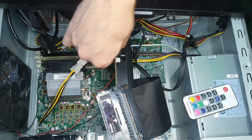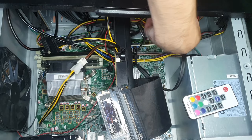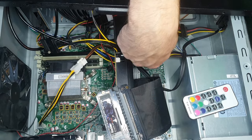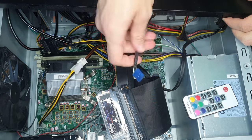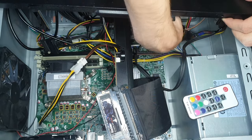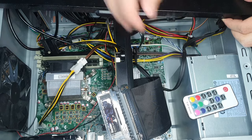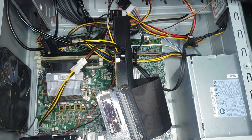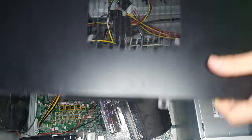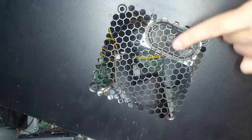Only do this BIOS modification if you're comfortable doing something like this. With BIOS modifications, the tiniest mistake can easily render the PC unusable. This cable with the blue header is not connected to anything. It's only there because it's in the same part as the original front panel USB, which does need to be connected in order for the PC not to give errors at boot up.